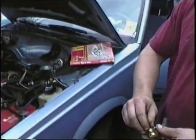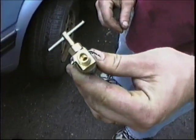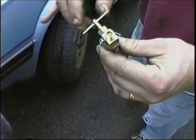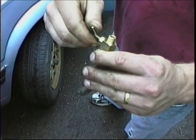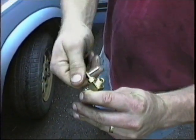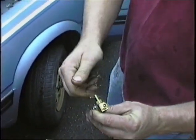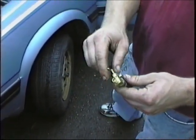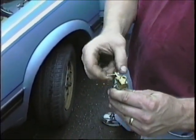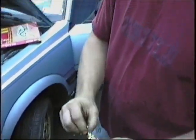This guy knows something about manual boost controllers. Would that work? Did you make that? Is there like a little ball and a spring in it or something? Well, it's a petcock valve. You screw it like this. I need something like a ball and a spring, something that could blow off, or be adjustable to the air pressure itself. Okay, yeah, this one. And then you just adjust the tightness of the spring or whatever. See, I made this for a manual fuel pressure regulator, but it doesn't seem to need one.